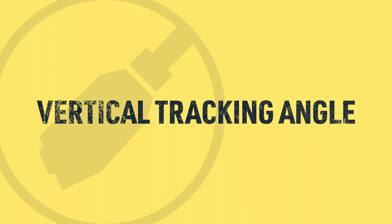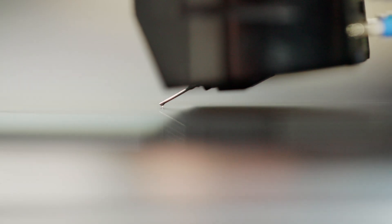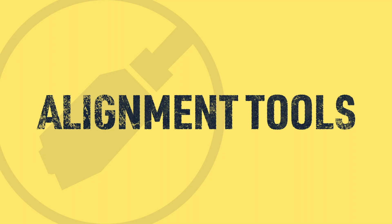Vertical tracking angle (VTA) is the last thing we're going to discuss today. It's literally the angle that the stylus hits the groove and makes contact. Each cartridge will recommend a tracking angle that is best. You can determine this with a microscope and a protractor, or using a macro lens, but if that's not possible, you want to make sure it's set up properly using the alignment tool that came with your table. If your table did not come with one, you'll want to get either the one it should have come with or a universal one.